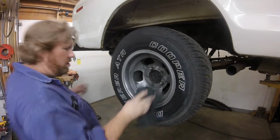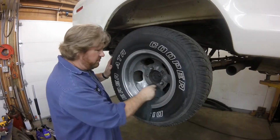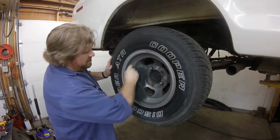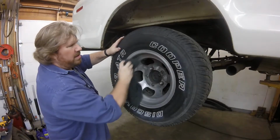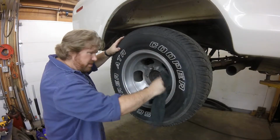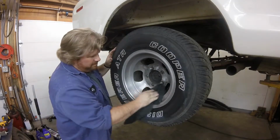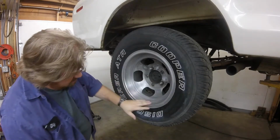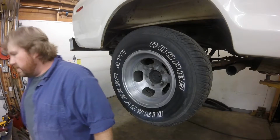I didn't do it with water last time. I probably should have, because it looks like it's gotten a lot farther already without having to put polish on it. I think dry was not the way to do it. That being said, squirt a little water on there, hit it with one of those. Oh yeah, that's probably going to save me a ton of time.